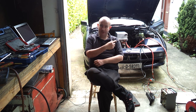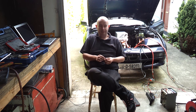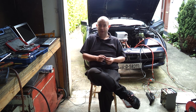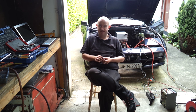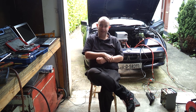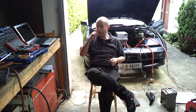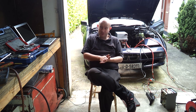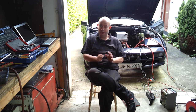Very interestingly, when I was doing that and just holding the car on the foot brake and creeping back and forward, I got about four or maybe five fully assisted presses of the brake pedal before it went back to its non-assisted state. Considering it's been probably about two weeks since I last spun the hydraulic pump, that's a very good sign for the accumulator and hydraulic circuit — it basically maintained pressure for that amount of time. Anyway, as always folks, thank you very much for watching, and watch out for the birds — stay tuned because we've got a lot of exciting stuff coming up.